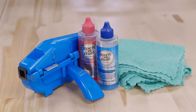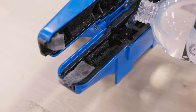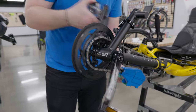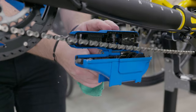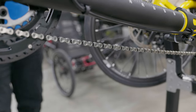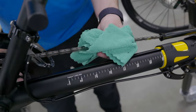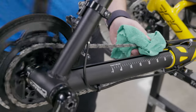Next, you'll want to clean your chain. Cleaning your chain is a simple process — you'll need some form of chain degreaser and a cleaning tool or rag. If you're using a cleaning tool, fill the bottom of the tool with your degreaser, then clamp it onto the chain and turn the crank arm manually as you hold the tool on the chain. As the chain runs through the cleaning tool, it will do all the hard work for you, leaving you with a shining chain once you run through the length a couple of times. After you clean the chain, run it loosely through a clean rag to remove any extra degreaser. If you do not have a chain cleaning tool, spray the degreaser on a clean rag, run the chain through it, then dry it off the same way.